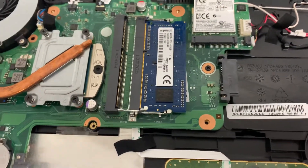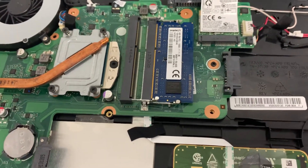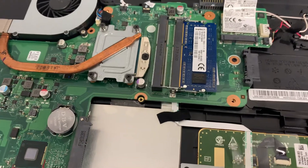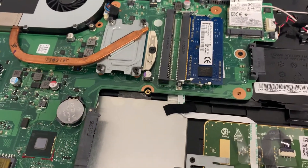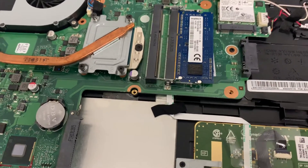The system will probably shut itself off. If it doesn't, power it down, go ahead and turn it back on and you'll see that your BIOS password will be removed. Things to keep in mind: don't touch anything else besides just that B500 jumper and you should be good to go.